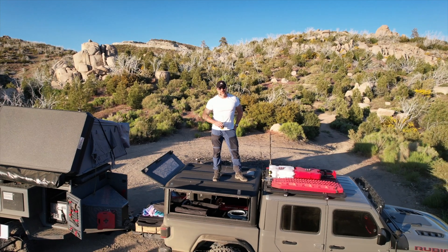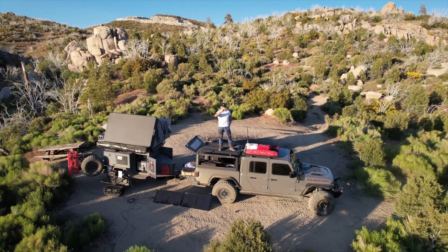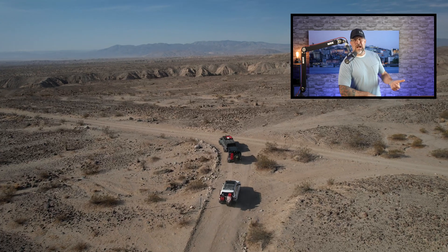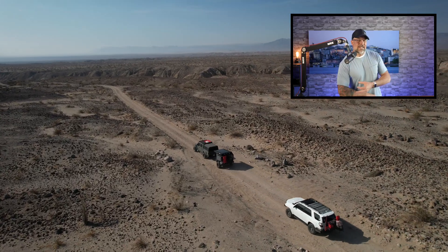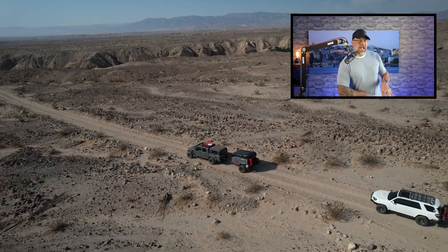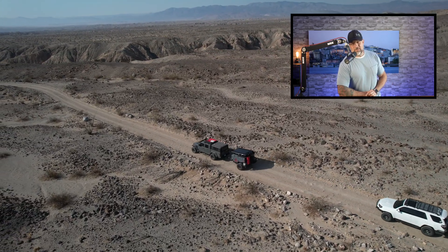Though AGM batteries do have their benefits, I'm going to stick to lithium battery features since that's what I've had the best experience with. My Expedition trailer doesn't have a huge amount of electrical components, so I just have a couple hundred amp hours of batteries — more than enough for running the trailer's lights, diesel heater, water pump, and charging devices. If you have a bigger trailer, you might want to consider larger batteries. Ultimatron offers 180 amp hour and 280 amp hour options. Keep in mind that as you add more batteries, this adds more weight and takes up more space in your rig.